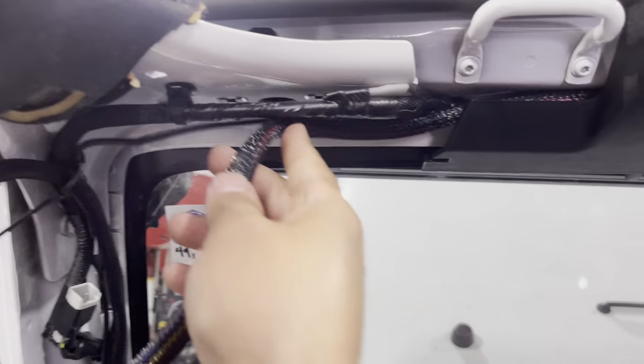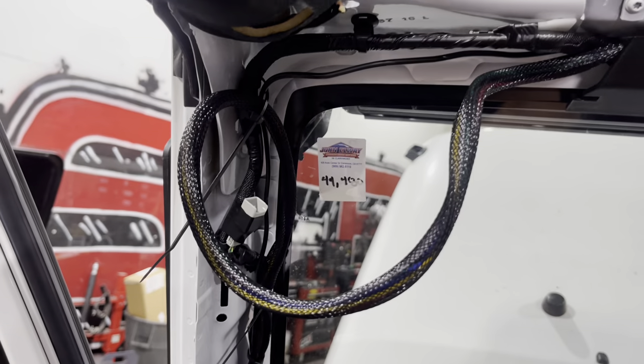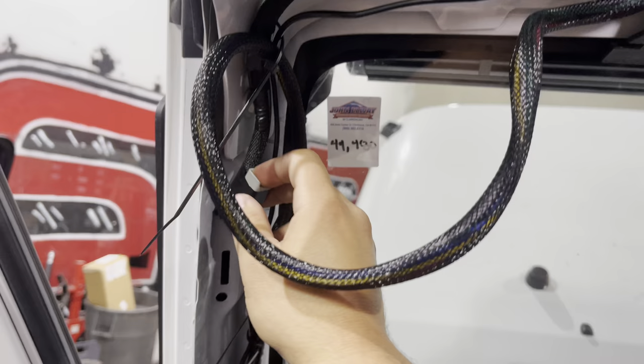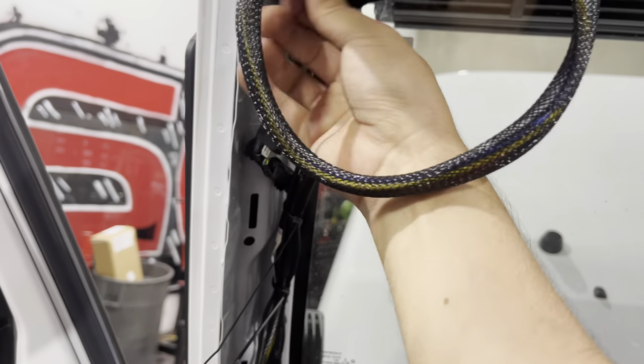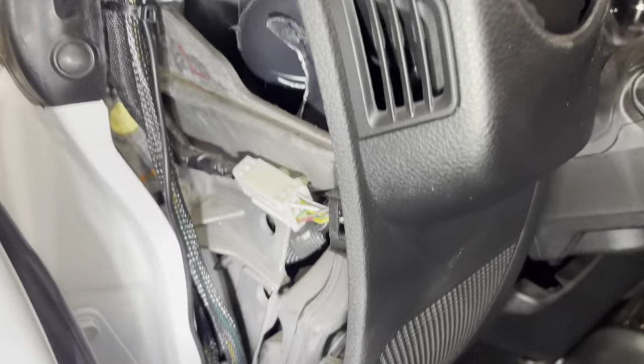For this part, I'm going to put back this panel now. When you put the other side on, you slide it into there first so that this piece tucks into the other part. I'm going to pull this excess wire down there, and don't forget to plug back in your microphone if you have one. The side panel comes off so you can run the wire from here, and the part that's going to run to the outside is the skinnier white plug.